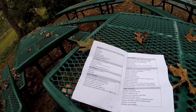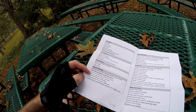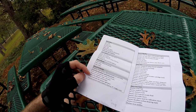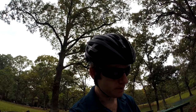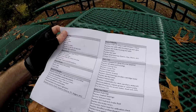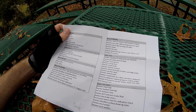Now we're getting into more of the deeper things, where you might need some specialty tools. Every few months: replace the chain, lubricate pedals and cleats, lubricate your shifters and brake pivots, remove and clean the cassette — that does require some specialty tools — and check all bolts for proper tightness. Replace chain every six months. Replace cleats and bar tape every six months.